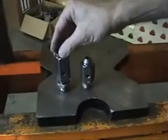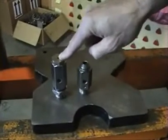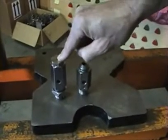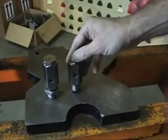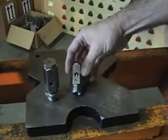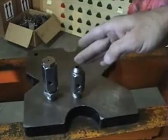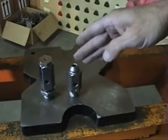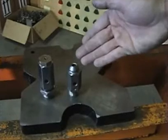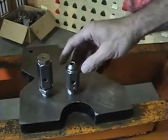Let's take a look at the two styles of regulators that you'll typically see. This is an early pressure regulator with an adjustable top — you can remove the top, shim it, and tighten it back down. The later motors used a non-adjustable style pressure regulator, and this is what most people are going to find in their cars. We're going to show you a very inexpensive and effective way to modify this regulator to keep you from having to spend the money on the expensive regulator.